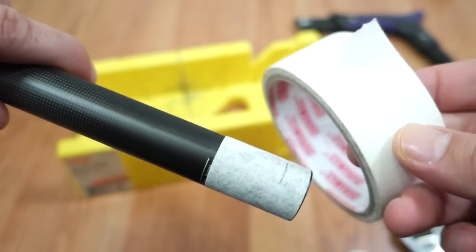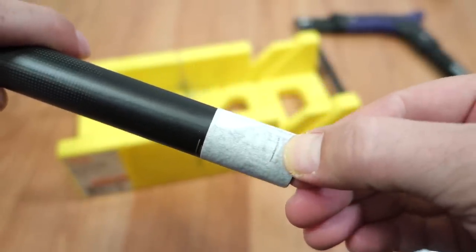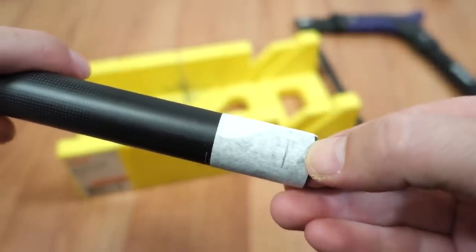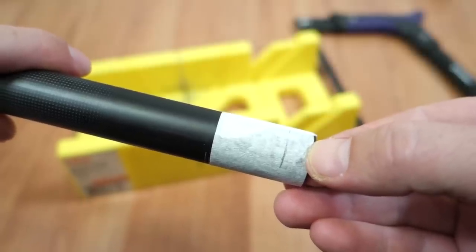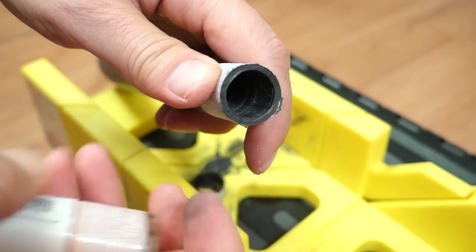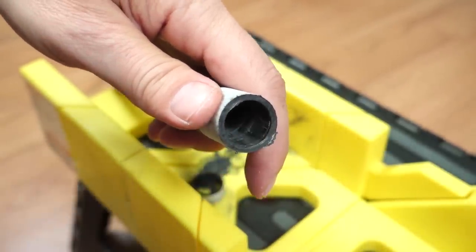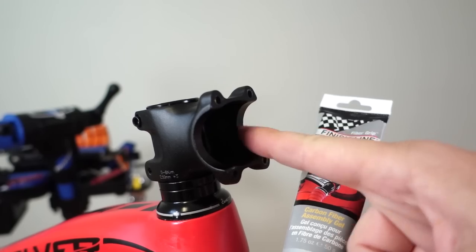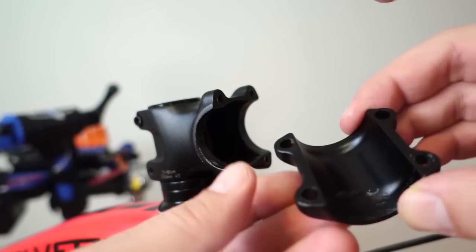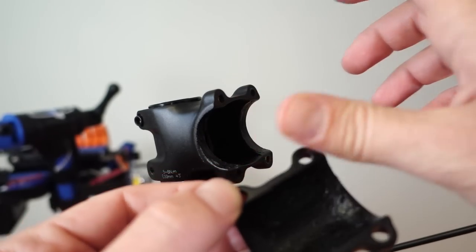Because my handlebar is carbon, I first wrap it with masking tape and then mark my 10 mm cut line. Cut slowly through the masking tape to make sure the carbon fiber stays together and doesn't fray at the end. Use that miter box to make a nice clean cut — my cut is pretty clean because I took my time. Some people prefer to use nail polish at this point to cover the cut end so it doesn't fray in the future. For a carbon handlebar, use a little bit of carbon paste at the touch points where it contacts the stem, and do the same on the stem plate. If you're using aluminum you don't really need to do this, but it won't hurt if you have carbon paste around.